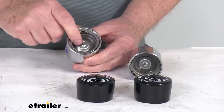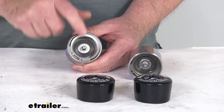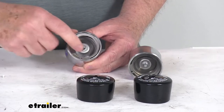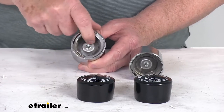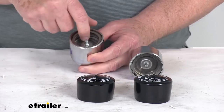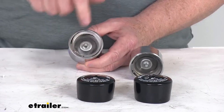Right here in the middle it provides this easily accessible grease Zerk fitting, so it makes adding grease to your bearings very quick and simple. You just connect your grease gun to there and pump the grease in. It will maintain a slight controlled pressure of about 3 psi with the spring-loaded piston right here, and this will prevent water from entering your hubs.